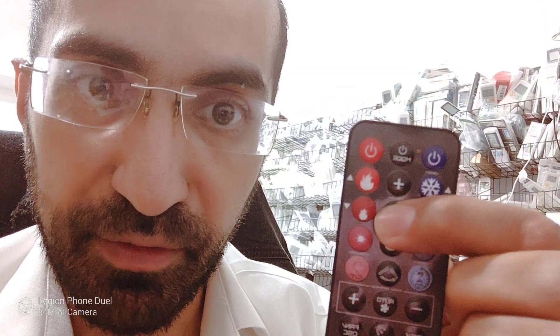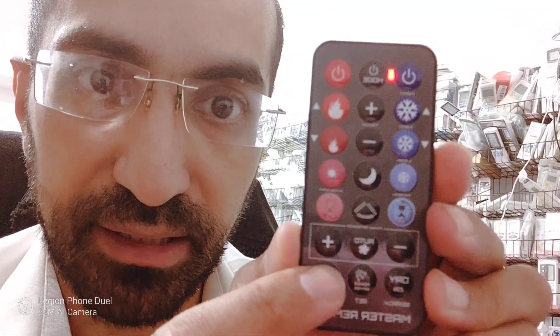If your device didn't react to all of those codes, then you need to do the following. Press and hold the search button again so that the light stays on, then press the select button once — you've changed now to remote number two. Test some of the keys to see if the device reacts. If it doesn't, press the select button again to go to the next code, and keep checking. Remember, there are only 15 or 16 devices installed in here. Once you find your remote, it will be saved in here forever.